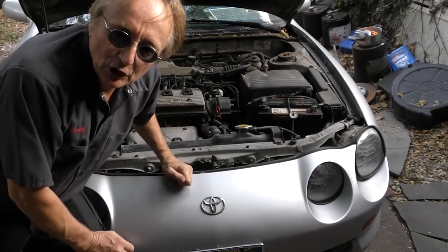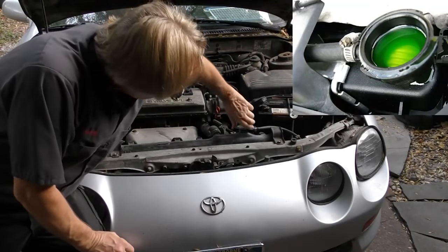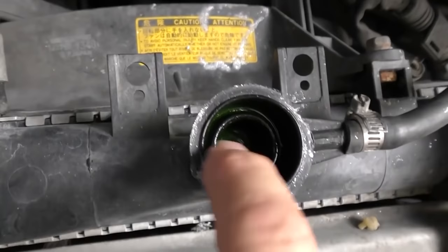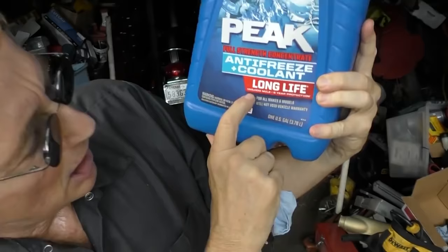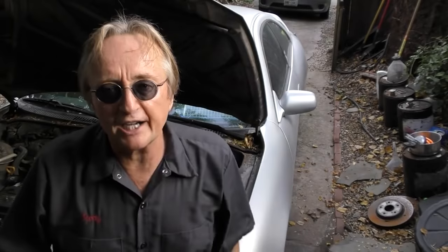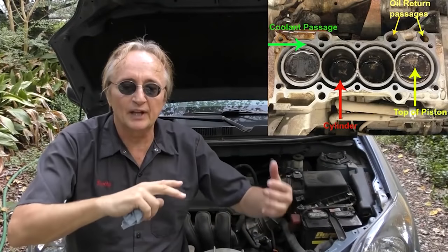The fifth thing not to do is forget to change your coolant if you keep your car a long time. An older car with the green coolant needs it changed every three years. More modern cars use extended-life antifreeze rated for 150,000 miles or five years, and even newer ones are rated for seven years. If you're cheap like me and drive your cars 15, 20, or 30 years, you need to change the coolant when it's required. If you don't, it can ruin the water pump and the engine head.